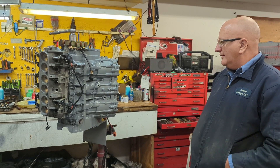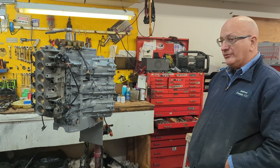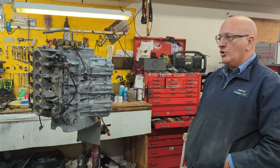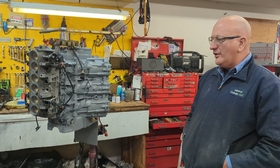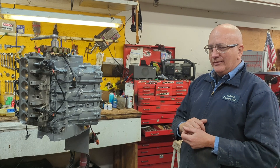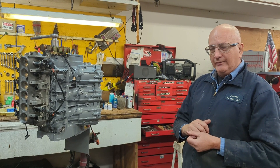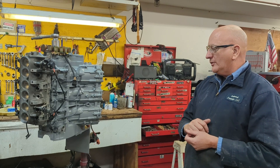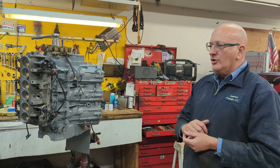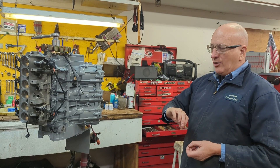A quick brief explanation of electrolysis — the real term is galvanic corrosion — is when there are two dissimilar metals on the galvanic scale in an electrical environment. Salt water is an excellent electrolyte, and fresh water is also an electrolyte, not as bad. They will cause corrosion because the metals have different charges, and metal will actually be removed by that corrosion.